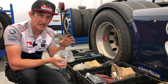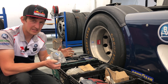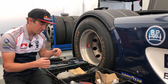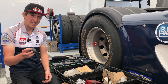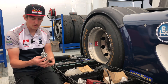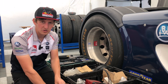At the very front of storage are the parts we need instant access to. We've got steering pumps — we actually run a PE steering pump, which I'll be honest, I thought wasn't going to survive the sheer pressures and extremes of truck racing. But we've been running a PE pump on the race truck for testing, one race weekend and a few other tests, and no issues whatsoever. We also carry some rose joints for the steering and rear torque bar, then we have some wheel nuts.